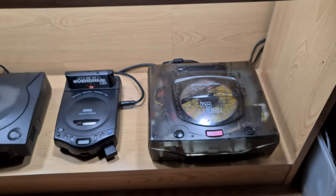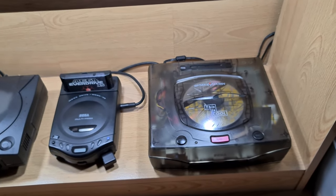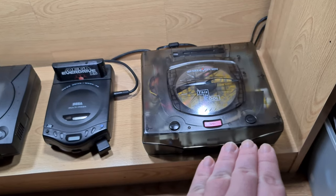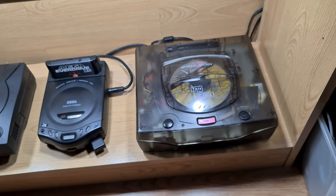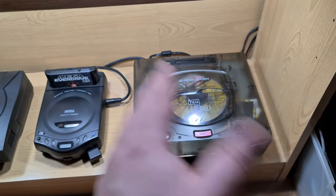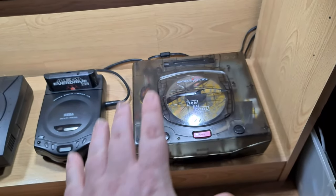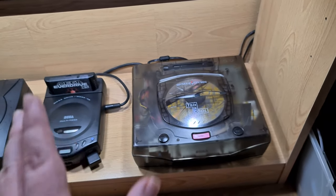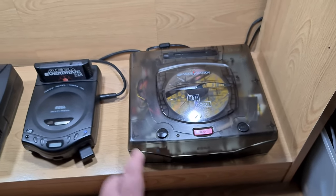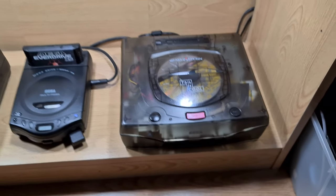The white cable was basically bent so angularly inside that it broke contact — so it was losing contact and the laser would just give up. What I've done is put two longer cables in there, let them press against the top just gently, and just wrapped a thin bit of Kapton tape around just to hold it gently in place so it doesn't wobble around. It's insulated on the bottom as well. These ribbons are straight as factory, and people bend them at all different angles and it just breaks them. So I just pushed it down gently and left it. It works — I'm not going to mess with it. I don't have any spare cables, so for now it's staying like that. But yeah — 50/60 Hz, region-free BIOS, it'll play everything. The see-through system is so cool. That's the Sega Saturn.